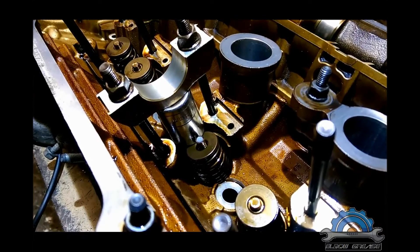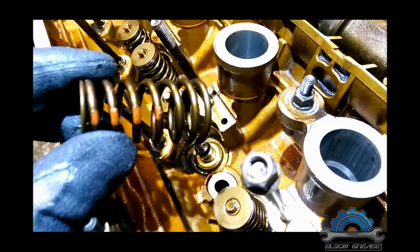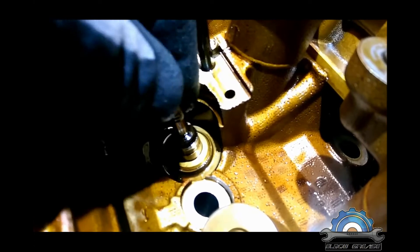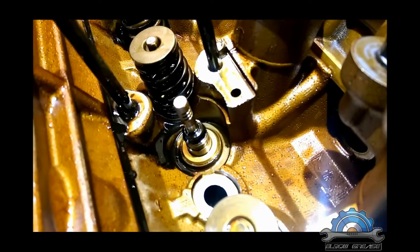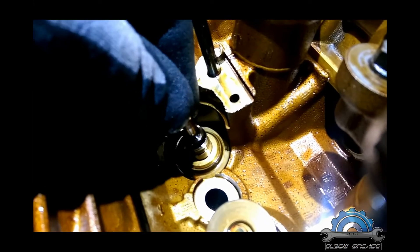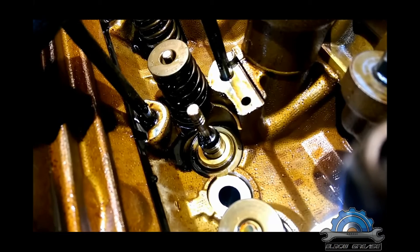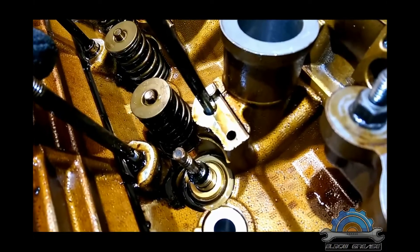I've just removed the tension from the spring. That's the spring, that's your valve stem, and these are the valve stem seals. These are very common in any car, any engine, because they're made of rubber. When the rubber gets old, that's the spot where oil can get through, get into the combustion chamber, and burn — creating smoke usually on idle or high revs. This is a pretty common cause of oil consumption.